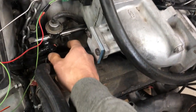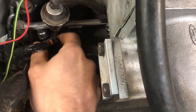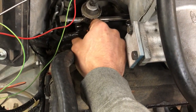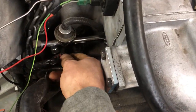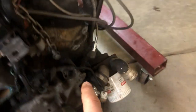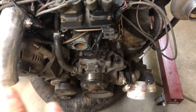As far as the fuel system, the injector connectors are different. On this one I have the earlier-style square EV1 connectors. The later ones that this harness originally had are more round. There are adapters available, but for me I just cut the connectors off a Dodge Durango in the junkyard — they have really nice rigid tabs to keep them secured — and wired those in. You will run into that if you're using an earlier or later harness with a mismatched engine. The injectors themselves are the same flow rate, but the connectors are different. So the key differences are: injector connectors, TPS, oil pressure sensor, and cam position sensor. Other than that, the wiring harness is the same.